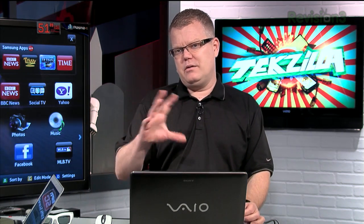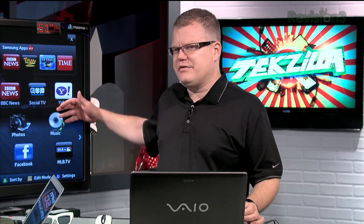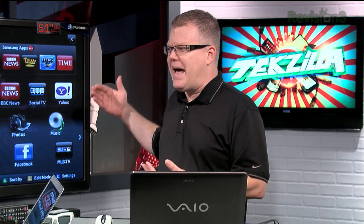Who should be buying a plasma versus who should be buying an LED flat panel? I look at the room environment — that will really determine which TV would be better suited for you. If you're dealing with any kind of light striking the screen, sunlight in particular, plasmas really don't put out enough light to keep the image bright enough to produce a well-contrasted picture in a brightly lit room. That's where an LCD with a matte finish screen would probably be ideal.